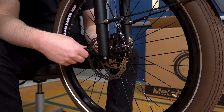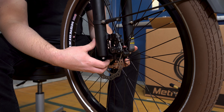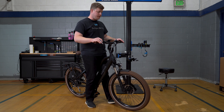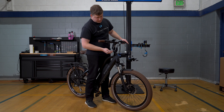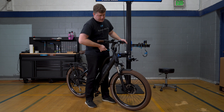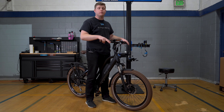This is a righty-tighty action and we're just going to keep going. As we get close, we're going to start testing for resistance in the lever. You want it tight enough to where it leaves an impression in your thumb — that's a good rule of thumb. The last few things to check before your maiden voyage: make sure your handlebar assembly is in line with your front wheel and straighten that up. Using a 4mm Allen wrench, tighten these two bolts, getting them snug, then use the T-handle portion to really make them tight. After this, I recommend a nut and bolt check — go through the bike, make sure everything's nice and tight. Then take your bike around the block a few times to make sure the shifting and braking performance is up to your standard.